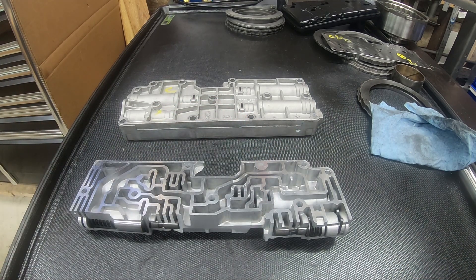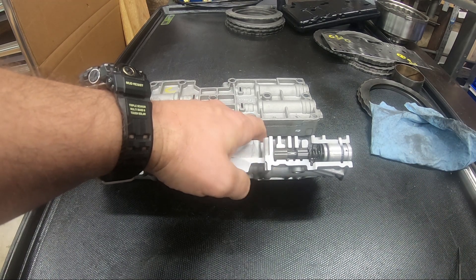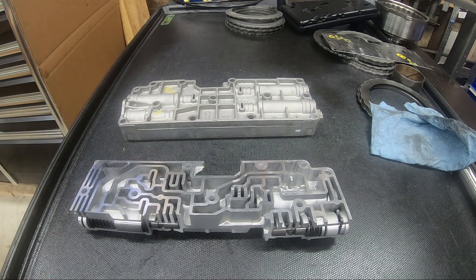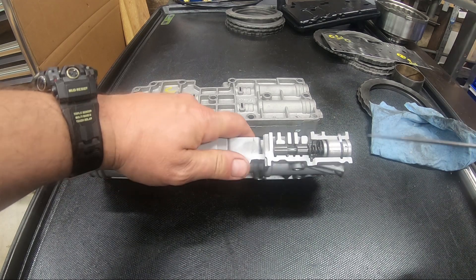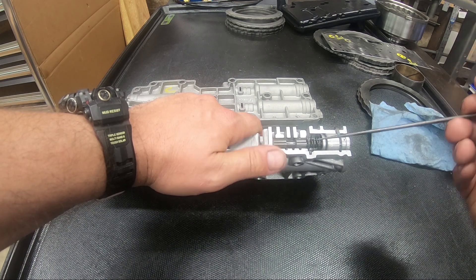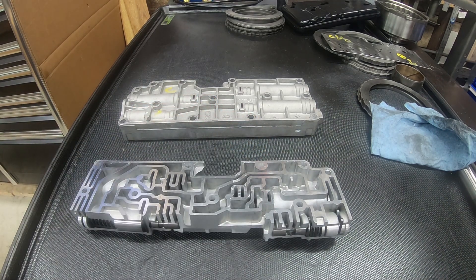When we're talking about firming up shifts, we're talking about pushing this valve to the left. There are two ways to do that: we can do it mechanically with springs and valving, or we can do it electronically. A good tuner who knows what he's doing will always ask if you have a built transmission or pressure mods, and that's why I always tell my customers whether they do or don't have pressure mods so they can pass that information along to their tuner. He can increase the EPC pressure and apply a greater force against this spring, which pushes the valve that way, or we can do it with a larger diameter plunger.